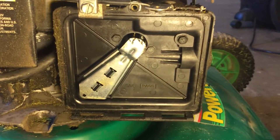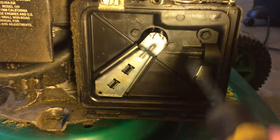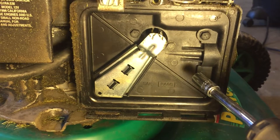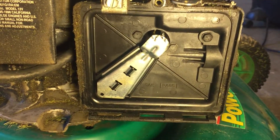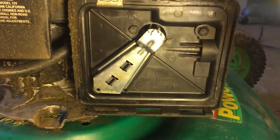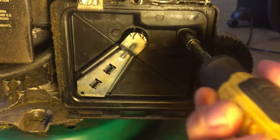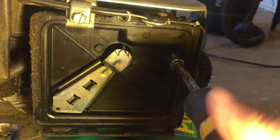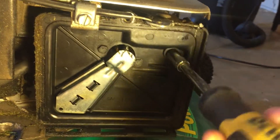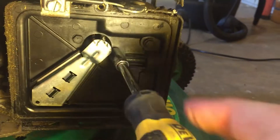The view is still a little poor, so I'm going to take off this cover which will get us to the carburetor. There is a gasket behind here, so if you can identify your leak beforehand and it's in one of the places already mentioned, you can fix it from there. But if you're still not seeing it, you're going to take off this filter backing that goes to the carburetor. Just know that once you open this, you might make that gasket unusable.